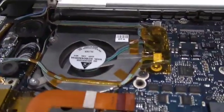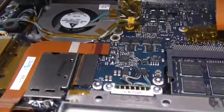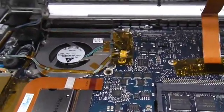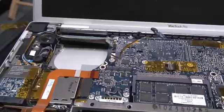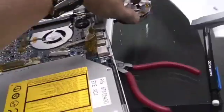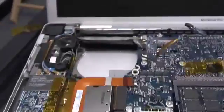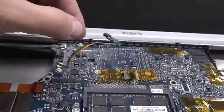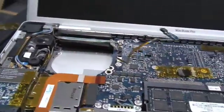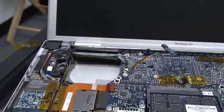So I'm going to shut it down now and see what I can do to remove the fan. I'm going to have to remove a couple of cables out of the way, detach the cable connected to the fan — there's a piece of electrical tape that holds it in place — and loosen various screws. So it's going to be tough. Here we are now with the fan removed completely. I probably did not have to separate them as the new fan comes as one unit. I had to move what I think is the light sensor for the machine, but besides that I didn't have to disconnect anything except the fan itself.